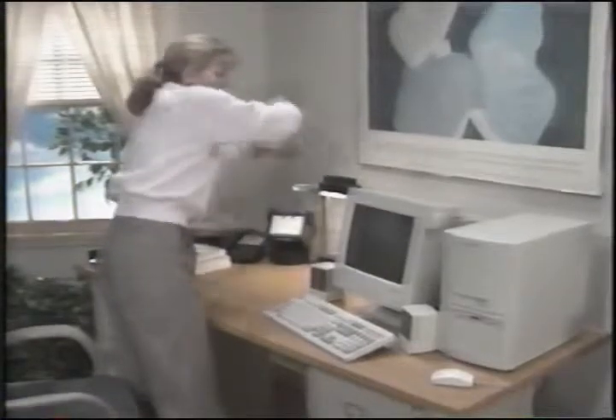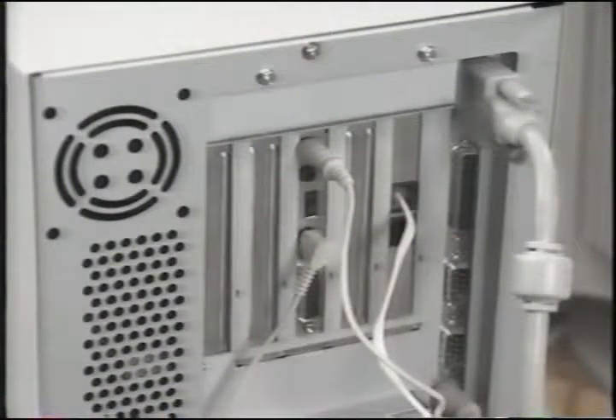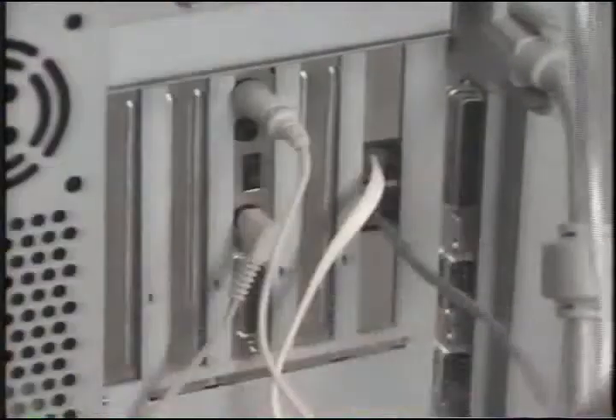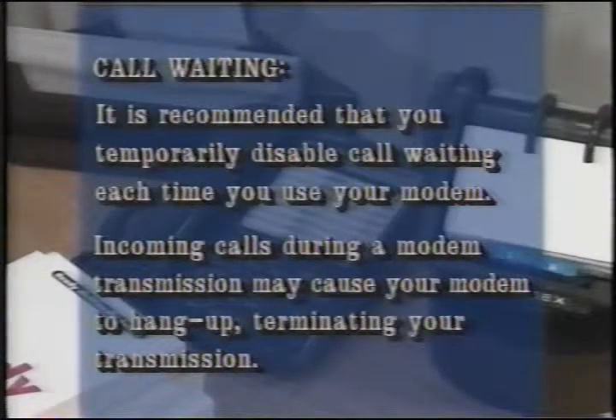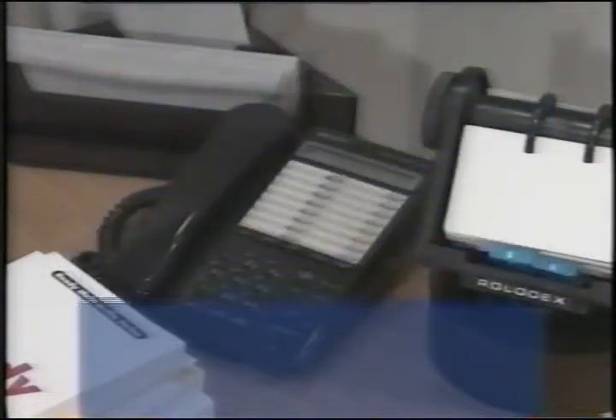Disconnect your telephone and use the cable from the wall to connect the modem. Connect the phone line from the wall jack to the top modem port. Next, connect the phone cable that came with your system, then reconnect your phone to the other end of this cable. Now your PC can send and receive messages. If you have call waiting, you should disable it each time you use your modem — incoming calls during a modem transmission will cause the modem to hang up. Contact your local phone company to find out how to temporarily disable call waiting.